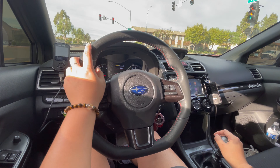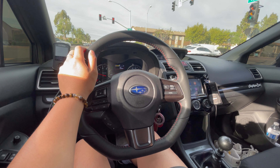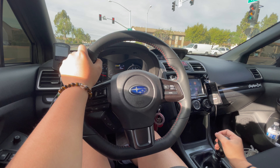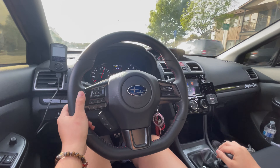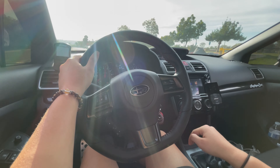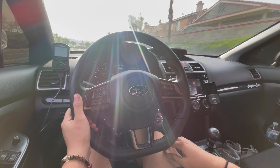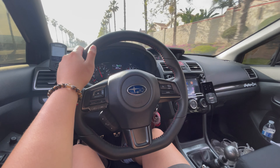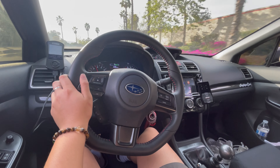The burble map is obviously a no-power map — it's just made for cool sounds, but it can burn up your O2 sensor and mess up your cats and spark plugs. Honestly though, it's really fun. I'm probably going to flash back to the power map tonight. It does actually kick in pretty good — you can feel how much more torque it has compared to the Cobb map. With the other tune there's not much to show since it's not a pro tune, but just imagine the Cobb Stage 1 tune, just faster and with more torque. I heard it's also better than the MA Performance Stage 1 OTS tune as well.